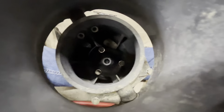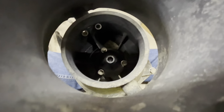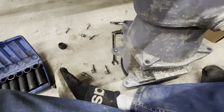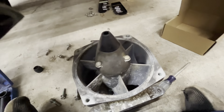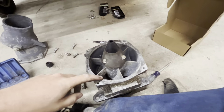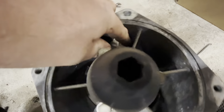This is the new wear ring and impeller — whatever they call them. As you can see, there's a touch in most spots with just a slight gap on the new one, whereas the old one has a gap all the way around it. You should have a gap all the way around, but it should be a lot tighter than what this one is. This one's all chewed up, galled up from rocks and sand and trash.